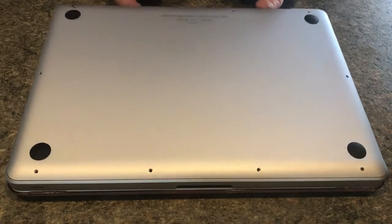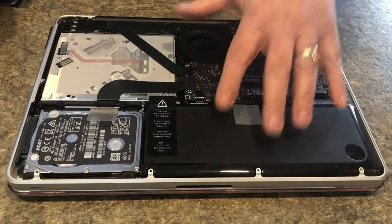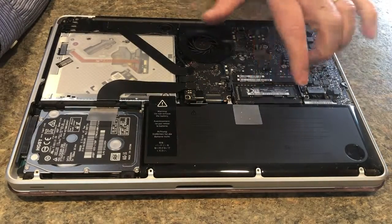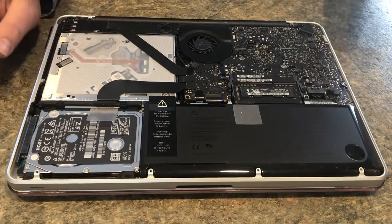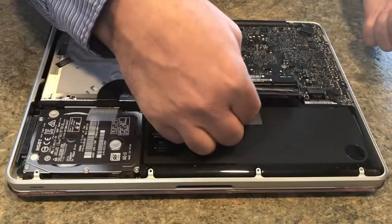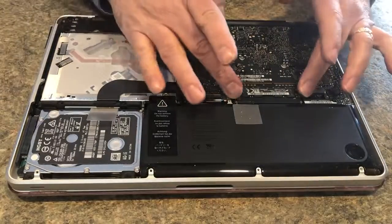Once you have it open, it's easier to remove the battery altogether, but this is the inside of your MacBook Pro — hard drive, CD-ROM drive, battery. If you have extended memory, the chip would be inserted here. Sometimes that does cause the unit to hang on boot-up or powering up. You can simply pull those little wings back. This unit actually has one, so you can see. All you have to do is push it back in and reseat it like that. You can try taking that out and powering up to see if that helps.